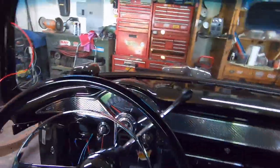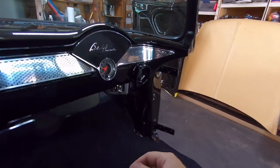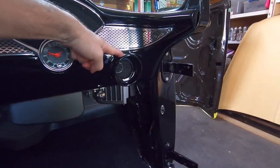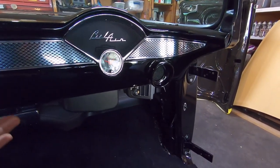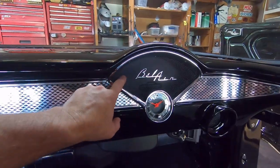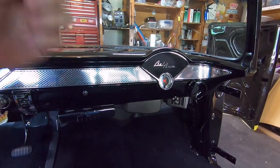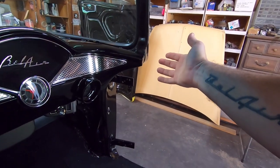If you got air conditioning on your 55 Chevy as an option, you would have had some chrome pods here, and that's kind of what I was going for. These are actually speaker pods — I have three-and-a-half-inch Kicker two-way speakers in here. These are exhaust tips I bought at Pep Boys. I cut them, removed all the fiberglass from inside, and took metal mesh — basically screen wire — and tacked it in the back. I have a ring welded on the back with two studs so the speakers go over the studs and nuts hold them on, making them very easy to replace.